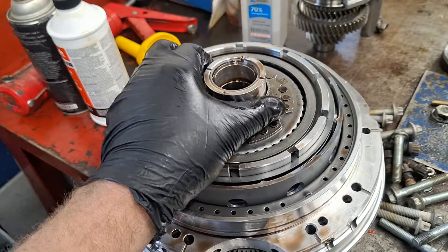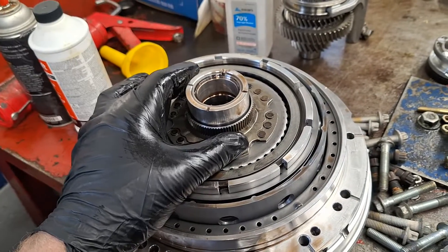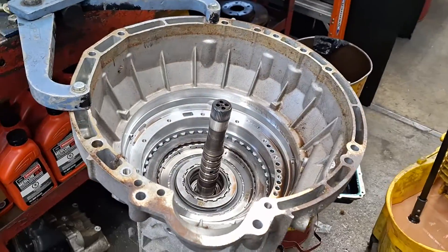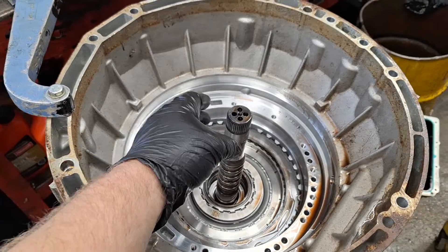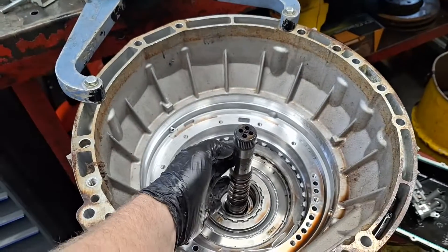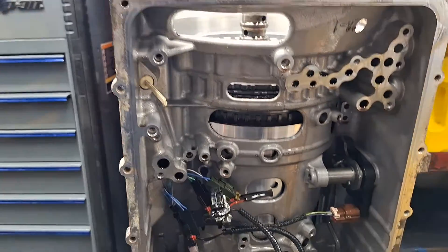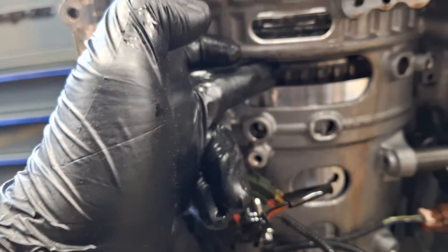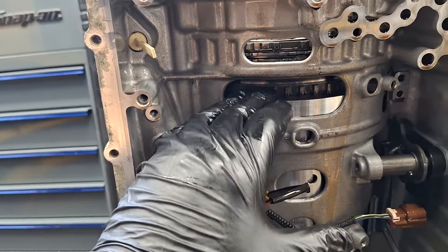It's tight clockwise and loose counterclockwise — that's good. If you see any metal shavings coming out, replace the one-way clutch. Once again, this is just a warranty repair, not a full overhaul. Before you take the internals out, come down here and notate the positioning of the drum — about one finger width. You want to make sure you get it back down about that far again, otherwise it's not fully seated when you go back together.